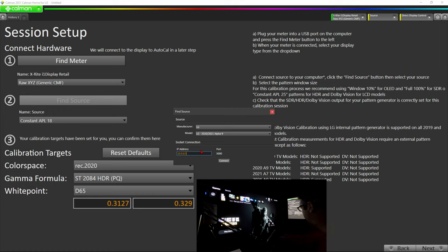Now we're going to set our peak luminance. First, measure the peak luminance by selecting that option — it will measure your TV's peak luminance in a 5% window. We got 730.4 nits in Cinema mode. Go up to the luminance bar and put in 730 nits, hit Enter, and the remaining values can stay at default. Come down and select Next. Now uncheck Enable Calibration — this turns back on the HDR processing in the TV. You will then validate the calibration against the HDR10 calibration targets. Select Next in the bottom right.